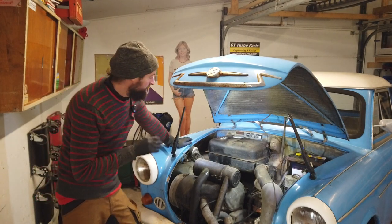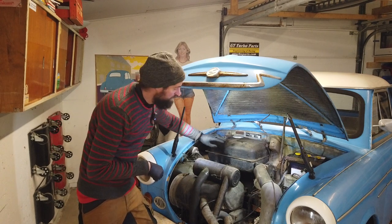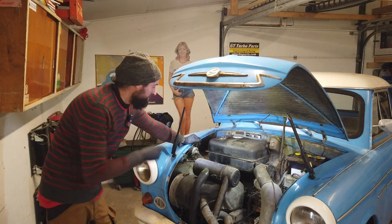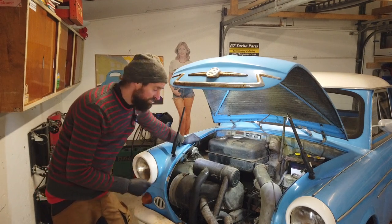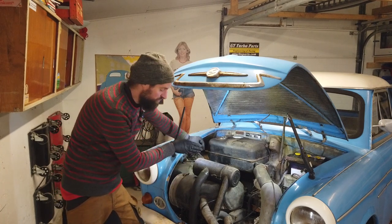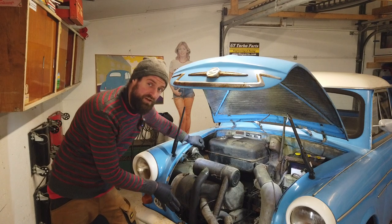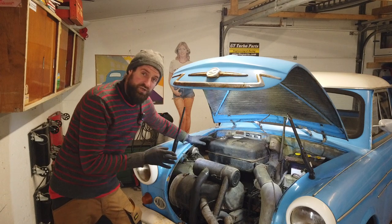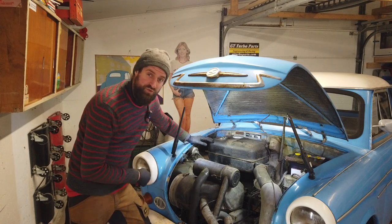But the main thing I'm going to remove for this video is the fuel valve - actually I think I'm gonna take the entire tank out just to check how the metal is behind that. I'm gonna rebuild the fuel valve, then remove the carburetor and also rebuild that. Stuff seems to work on this car, but what does not seem to work is the fuel doesn't seem to run to the car by itself before there is some kind of vacuum. That could be because of the needle valve in the carb, or it could also be the fuel valve. Something is wrong, that's for sure. When it runs, it runs pretty well. So just to be sure I'm gonna clean everything up and rebuild it and then it should be good to go.